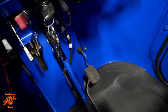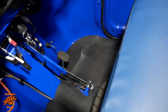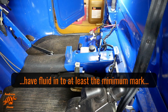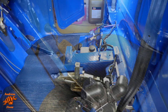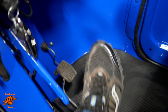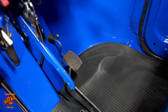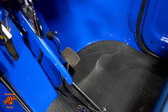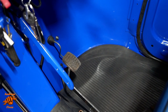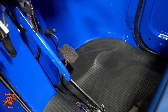There's where the front brake hose comes into the cab into a solid line — it goes under the mat to the master cylinder. I've covered that in quite a lot of detail in another video on changing the brake fluid. While we're looking at the brake pedal, give it a press, make sure it's firm and not spongy. On a test drive, you should get braking force well before the pedal gets anywhere near the floor. The other thing to make sure on the test drive is that it brakes in a straight line — if it veered to one side that would indicate, in the case of a trike, that one of the rear brakes is out of balance with the other.